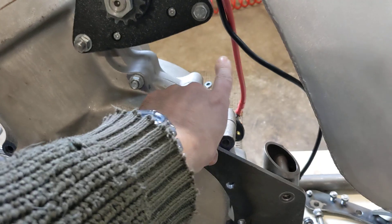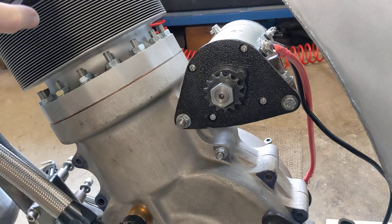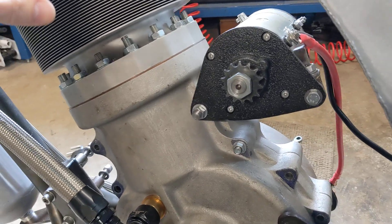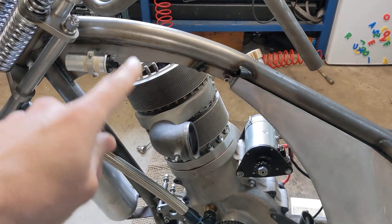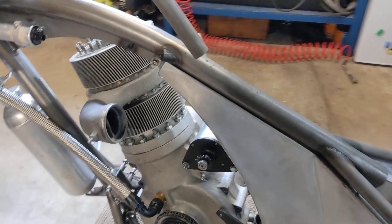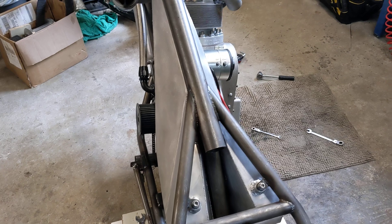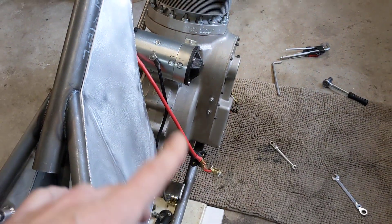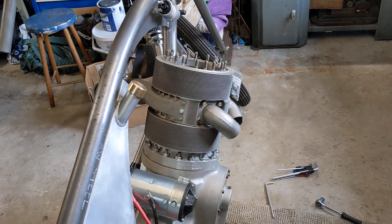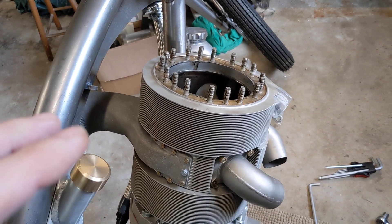When we connected up the Dynastart — you can see the leads are on there — we bowled it over. It doesn't turn the engine over anywhere near the speed required to get it started, and we kind of knew that. But I wanted to try it, because I didn't want to make a great big decompressor, fit it all, get it working really well, and then have somebody say 'what if you don't use the decompressor?' and press the button and have it start just fine — that would be a little embarrassing. So we tried it, and we definitely need to make and fit the decompressor.